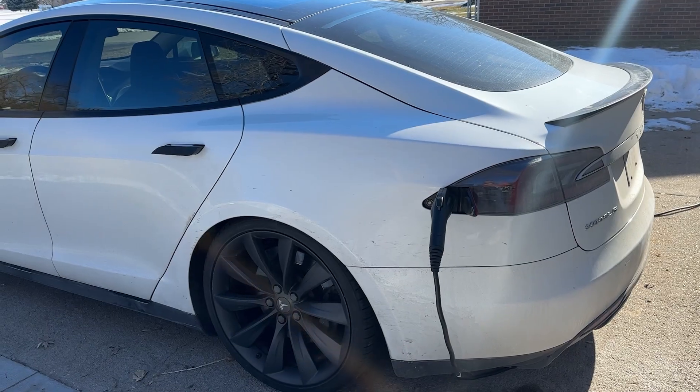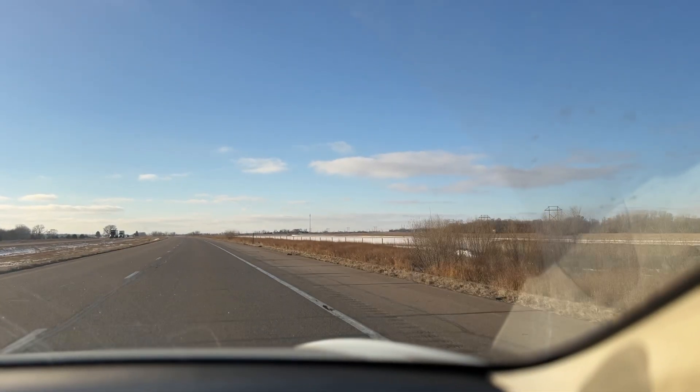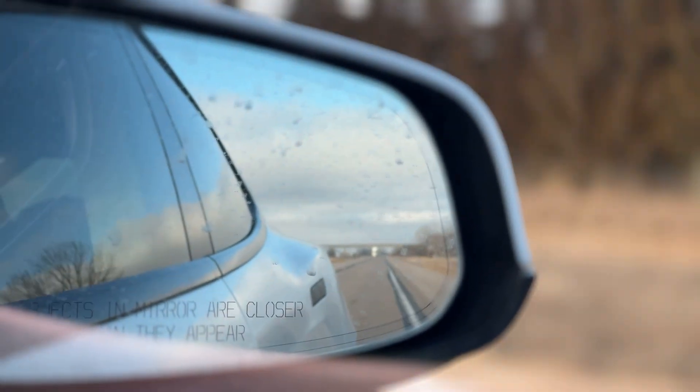What's happening is the rear is starting to come out underneath it when you accelerate, usually above speeds of about 40 miles an hour. So I'm just going to go through the whole rear suspension on this. We also have an airbag leak in there, so we've gotten the airbags for it and we're just going to replace all that.